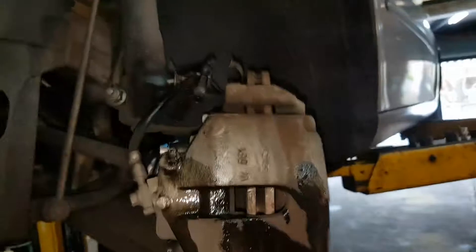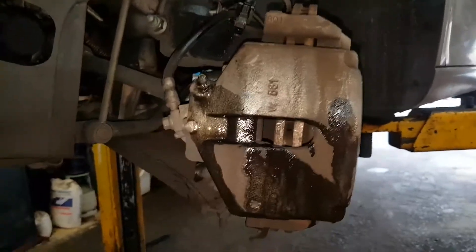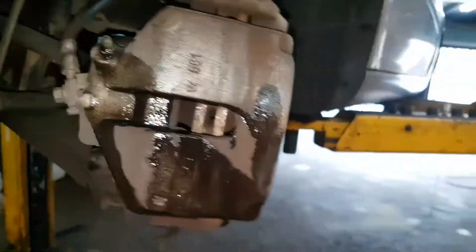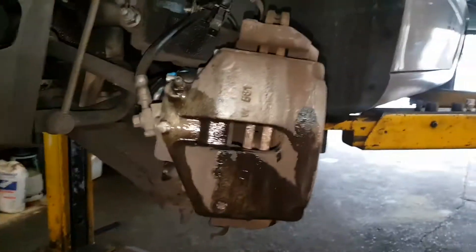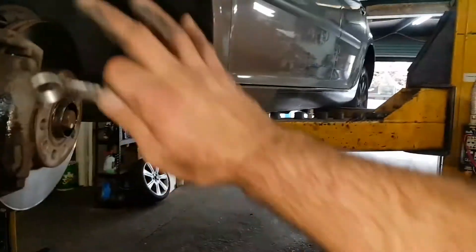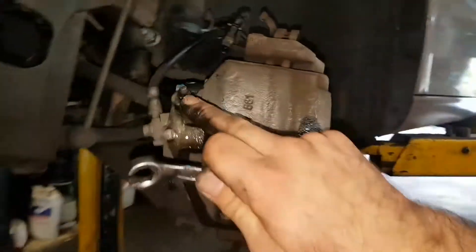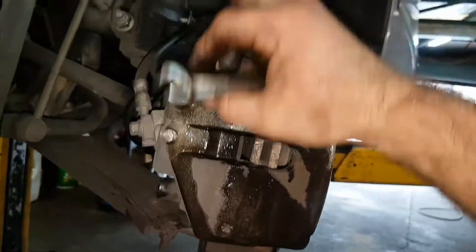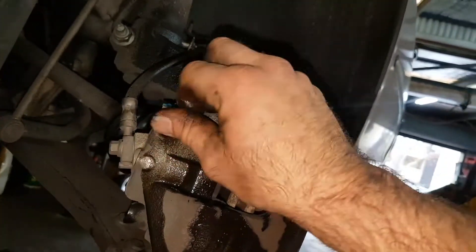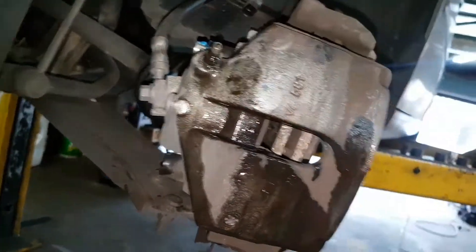If you want to go and re-bleed it, it's sort of showing you don't have any confidence in what you did and you might not have done it properly the first time. If you tip the caliper upside down, you're going to get air bubbles come out and you bleed it. These Golfs are notorious - so many people who've worked here have done especially the back brakes, which are different, and you get a low pedal. Not talking about ruining the handbrake actuator before you pump the brakes up, but you get a low pedal because the air is not evacuated - they haven't given it enough time. If these are blocked, doing that will unblock them, or you take it out and unblock it. As you can see, the brake fluid here is in pretty good condition.